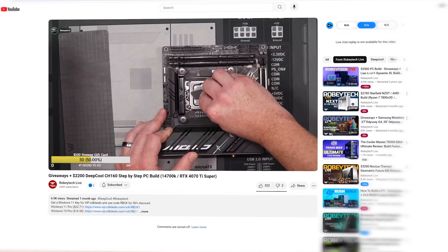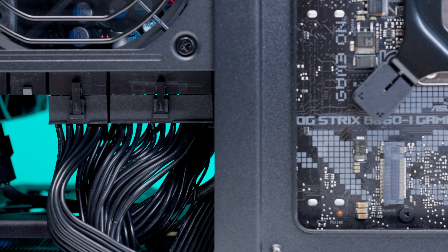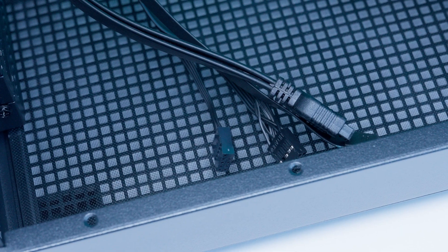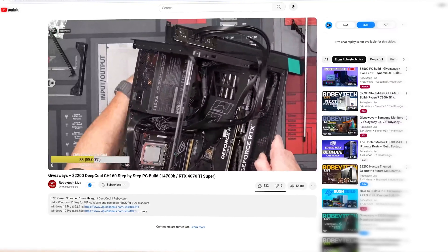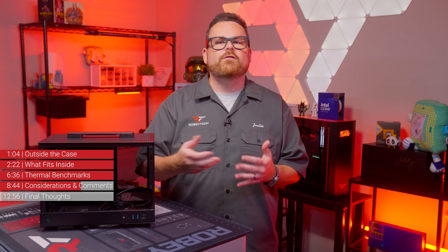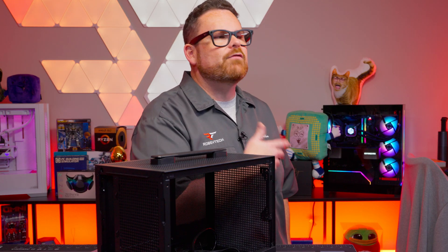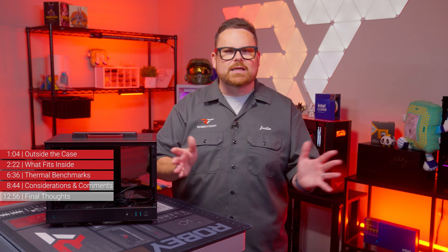We applied thermal paste to the CPU before installing the motherboard inside the case. Next came the fun game of identifying cables and checking where they need to run so we didn't fight for space or get caught in the GPU fans. This involved figuring out where USB 3 and USB-C front panel cables plug into the motherboard — for us, that meant running cables behind the GPU. We laid the GPU inside the case to ensure the fit, checked cable distance from the GPU fans, and then physically slotted the GPU into the motherboard. From there it became cable management — moving PSU cables, plugging in fans and ARGB, running power to the GPU, and finally installing the CPU cooler last. After a final cross-check and zip-tying everything in place, it was finally time to hit the power button. Once it hit POST, we buttoned everything back up and called it a day.